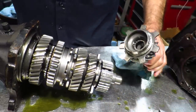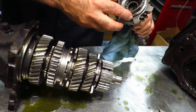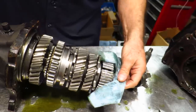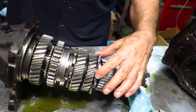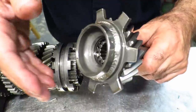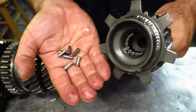This is a mod by Liberty's where they actually weld the face-plate onto the gear. You can see they did a very good job. Needle bearings appear to be okay — the tip of the main shaft didn't get chewed up or anything because of the misalignment. What I'm going to do simply with this one is get this input shaft replaced because the tip is messed up on it, and then put the box back together.